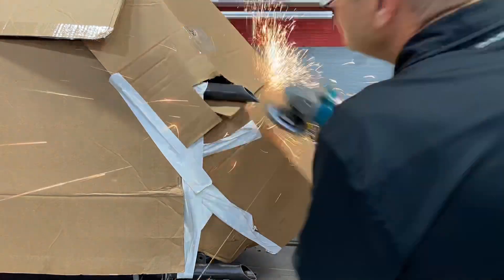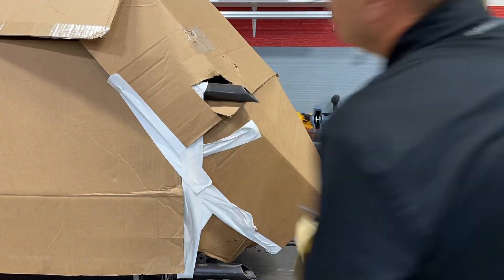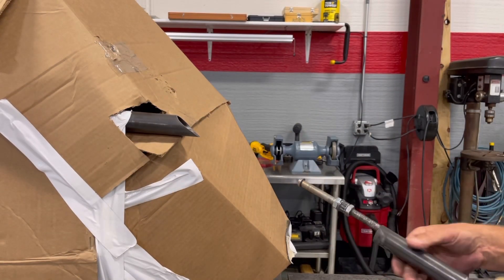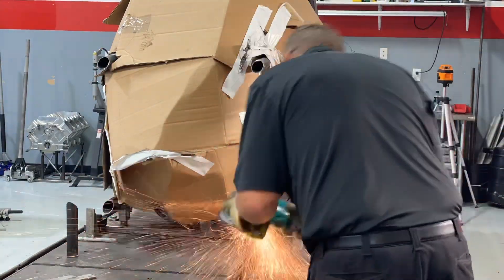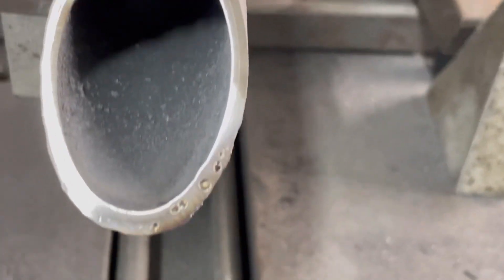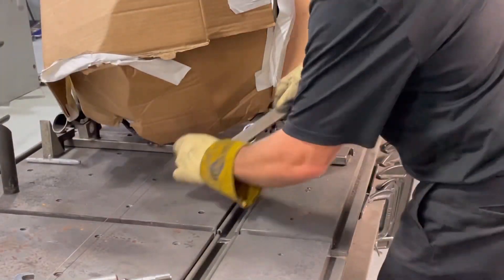After doing some of these other pieces, I determined that this was, in fact, the original front end — when this car was built, this was what was on it. Now, when chrome moly tubing is made, it actually has this scale on the outside. It's heat treated, drawn through dies, but that color on the outside is actually a heat treat scale. If you don't clean that off when you're welding two pieces together, this is what can happen — look at the inclusions on this weld. As I'm grinding this thing back, that's what I find. It's not good. If you're going to be welding chrome moly in a structural application like this, you better sand it, get the scale off of it, or this is going to happen. It's basically from dirty metal.